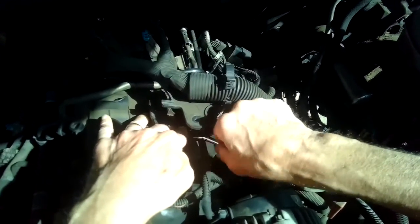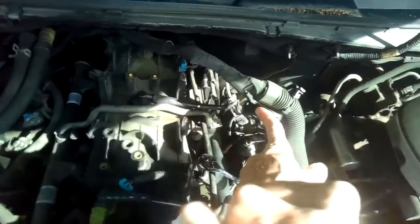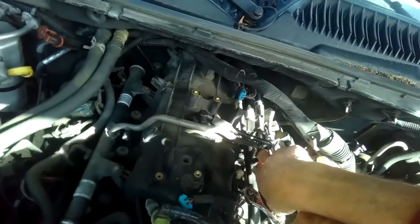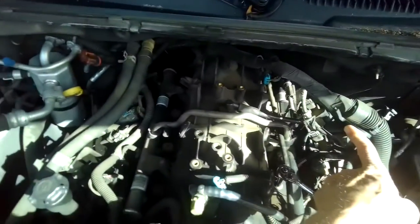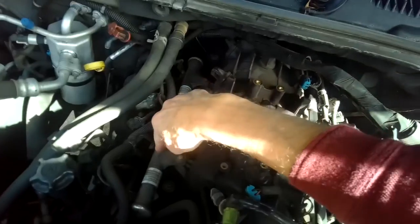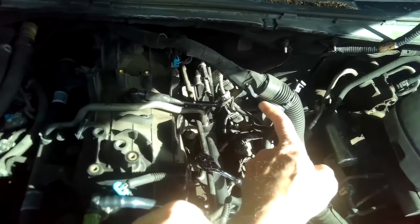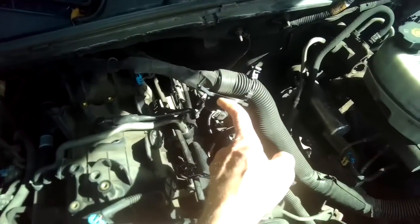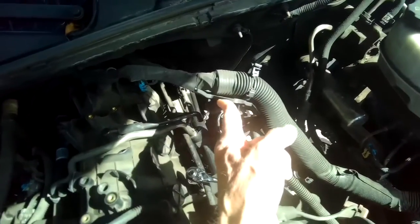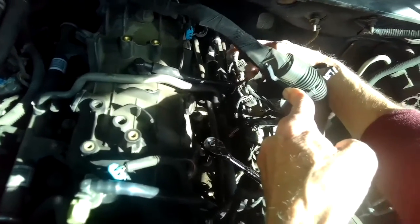And you don't have to disconnect this crossover to do this. Another option is you can leave that screw where it was. Take this little clip off too. And you can disconnect this one, this one, this one, this one, and all the connectors, and you can lift off this rail and this rail and this crossover as one piece. That's a good way to do it. A little bit harder to get everything to disconnect, but definitely possible. To do that though, you have to also disconnect where this fuel intake comes from, this hose, which is a little tricky.